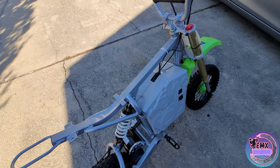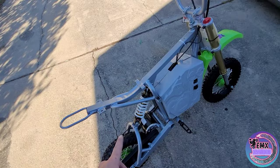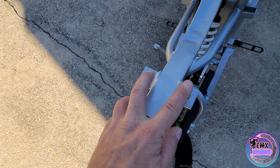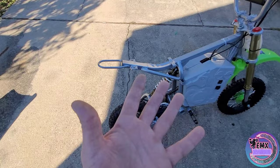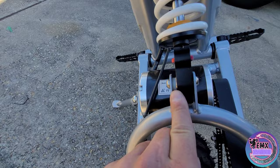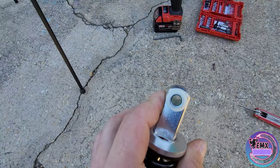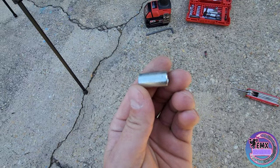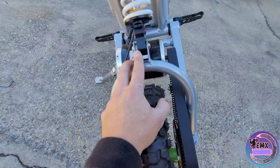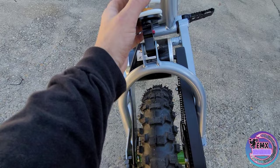Alright guys, just wanted to jump in here real quick. Taking the plastics off to get to the shock was extremely easy. We had one Allen bolt up top, one on the side, another one on the other side, and then two Allen bolts up underneath the seat — and it basically just slides right out. So five Allen bolts all together and the DNM shock is in. Now I did notice that there was a little bit of room left, so what I ended up doing was taking these little plastic bushings off of the stock one. I only used one side — they're basically just pressed into this little sleeve right here — and I kind of just filled the gap with one.